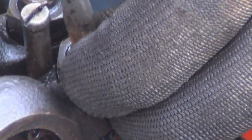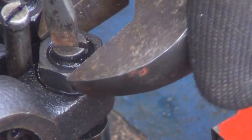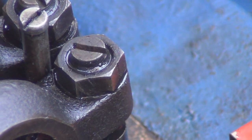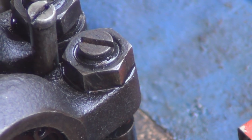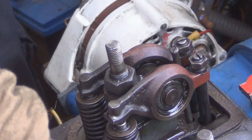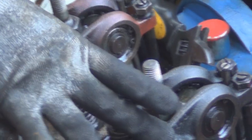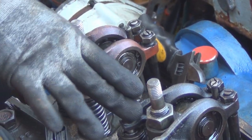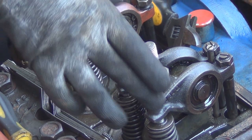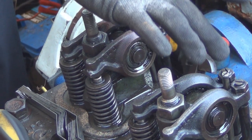Let me just tighten them up. Will it be fish every morning you think? Yeah, we'll go out and try something interesting - nearly out of Kveit. Will you start it tomorrow? Hopefully in a bit today, fingers crossed. Inlet. Nearly all done now, been worth it. The inlets can be set both together and then you do both exhaust valves together. At the moment you're at a point where the pushrods are as far down as they're going to go for the inlets and the exhaust.